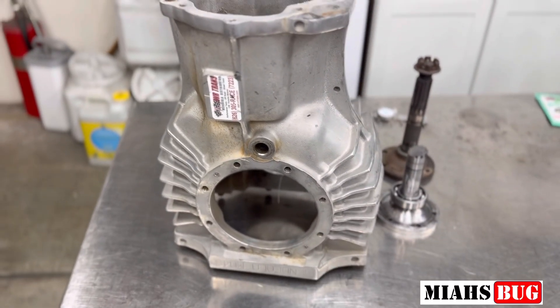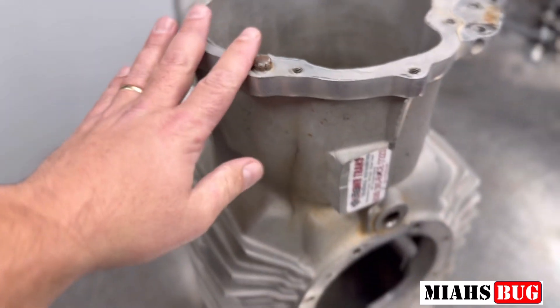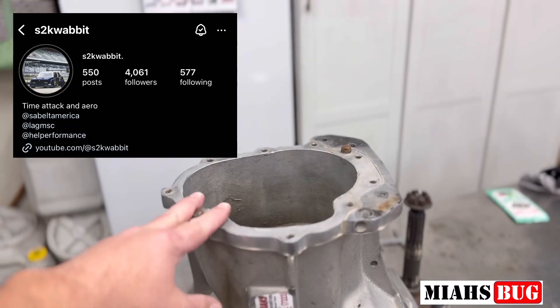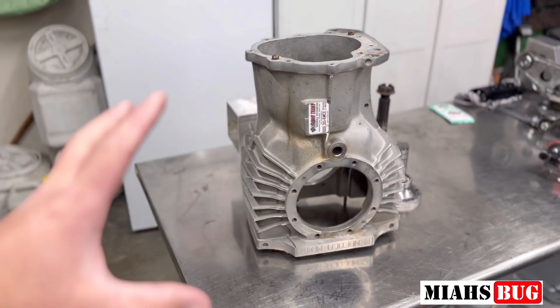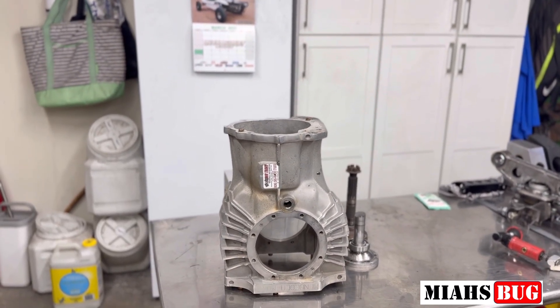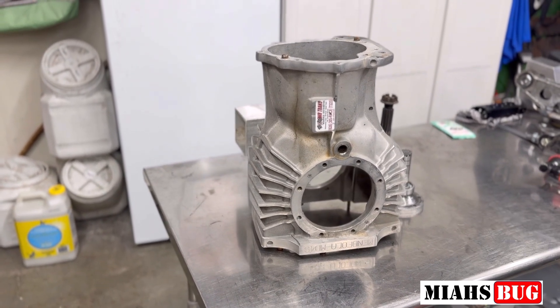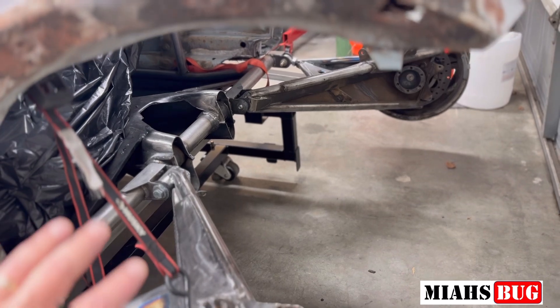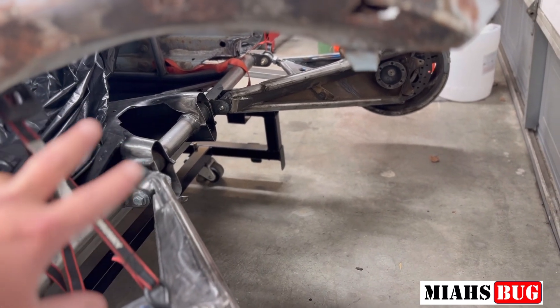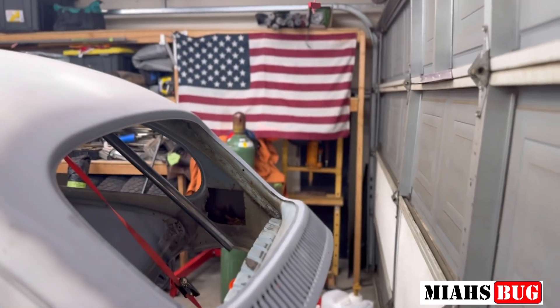You can see it's cracked — it's no good. But what am I going to do with this case? I need to keep building and I don't have the money to purchase a brand new Mendiola right now. So I'm going to talk to my guy S2K Rabbit — he's got a 3D printer. I'm going to get a CAD file for the Mendiola 2D, have him slice the model, and we'll be able to get the gear carrier and nose cone separated and print those. He'll also slice and print the bell housing in four sections and I'll glue them together. Then we'll have a mock-up transmission to put into the back of the bug to locate where the shifter rod is going to go, all the mounts for the Mendiola, and also where we're going to put our engine.